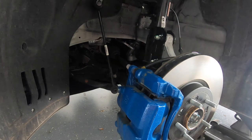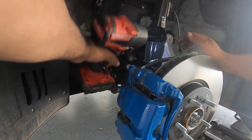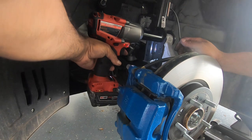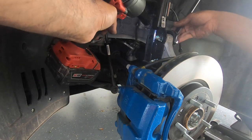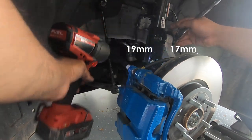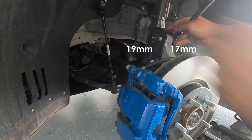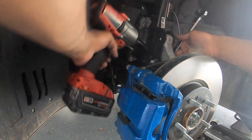So now I'm going to take my 19 and get these guys off — luckily this thing just kind of nails them off. Then it helps to take your 17, which is on the other side, and just hold it. It comes right off. On this one I'm just going to loosen it, and then I'm going to get the jack under it.